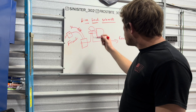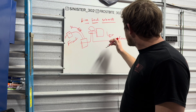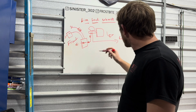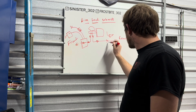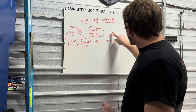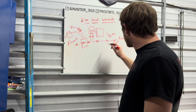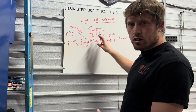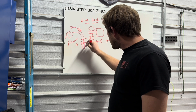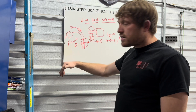When the switch is on and you push the brake pedal down, fluid pushes forward to the front brakes and also backward to the rear brakes. When you let off the pedal, fluid flows back the other direction. But with the solenoid engaged, the front fluid hits what I'd call the 'Great Wall of China' — it's not going anywhere. The pressure holds steady on just the front brakes, not flowing forward or backward.